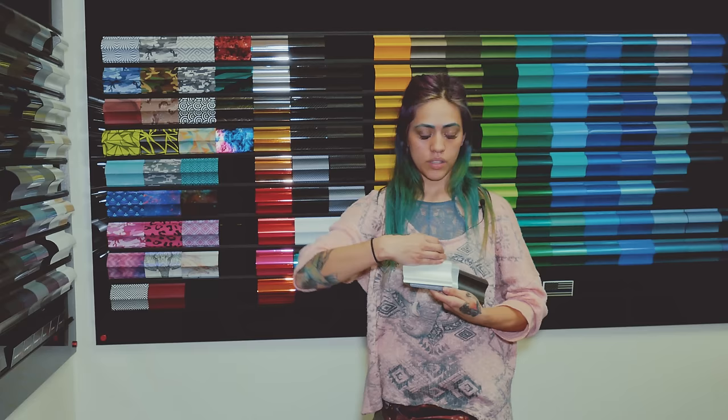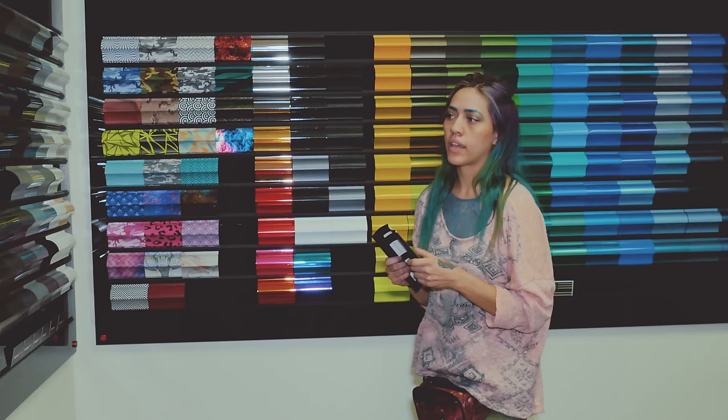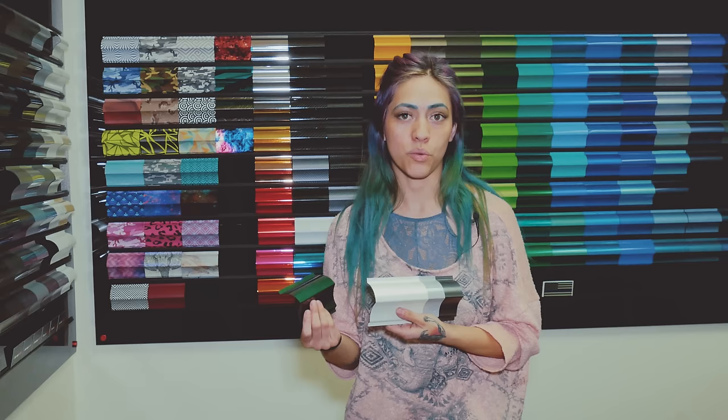Pearls — pearls definitely you can have problems with directionality, like these kind of pearl colors. And then the biggest ones, which is kind of newer to the market, is going to be the shade-shifting colors. So what we're using on that GTI right now is this Gloss Urban Jungle — any of these shade-shifting chameleon colors, whatever you want to call them, they usually have multiple colors in it. If you turn this film sideways it's going to have a different effect. You're usually going to use more film because it's directional and you can only orient your panels one way. The best rule of thumb if you want to avoid costly mistakes is to just cut stuff as if it was directional. It's a measure twice, cut once — do it right the first time. Don't risk turning a panel just to save yourself 10 inches on your roll of film.